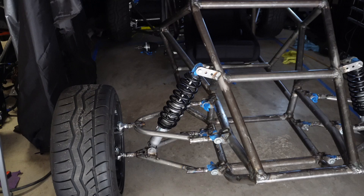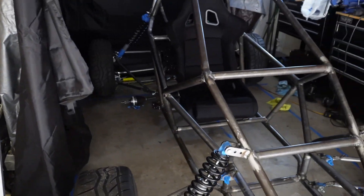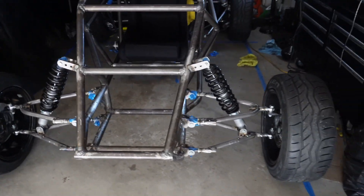It's the same process I've been showing you guys — the exact same workflow. Now that I have this 60-inch wide cart, I'm going to build like an 18-inch drivetrain, which is a bit crazy, but at least now I can put a limited slip differential on the back which will allow for better turning. I do have a full-time job, so this is definitely a hobby of mine — I'm not making any money off of this at all. I've actually been spending so much money on this that it kind of hurts my stomach. I'm still working on it tediously almost every day, trying to get things buttoned up and get everything perfect.